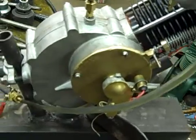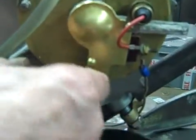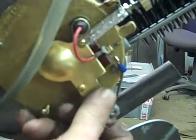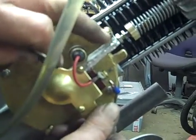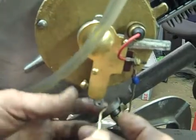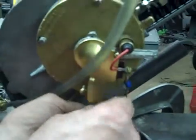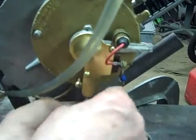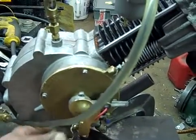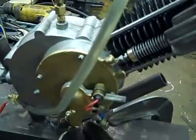And this is the decompression, and really I don't like using them the way they set this up, but basically when the cable is hooked onto it, which mounts down here, it comes up to this position, and as you lift up, this pushes the exhaust lever up. So for right now, I'm just going to tie this off for the bench test because we'll start this up later. So really this does nothing more than lift the exhaust valve up for decompression.